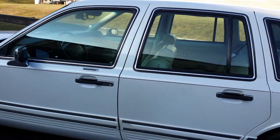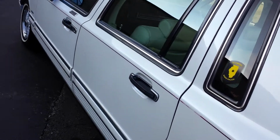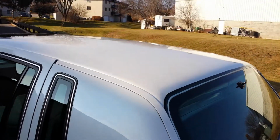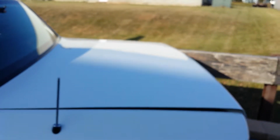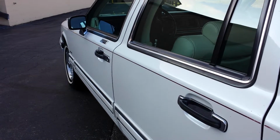When you do all those steps, a lot of people ask, well, how long is it going to last? You ever see those commercials where they say, oh, you can wax your car one time and it lasts for a whole year and we can do all these washes? There's no such wax out there. I've been doing this for years. But when you do all those steps of clay barring and buffing with the glaze compound, buffing with a wax, and sealing it with the pure carnauba wax, having something spin at 3,500 RPMs heats the paint up, along with the heating of the buffer itself and the compounds. That's how you get the paint to look like this.